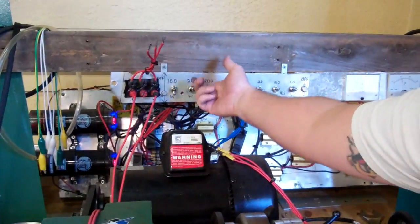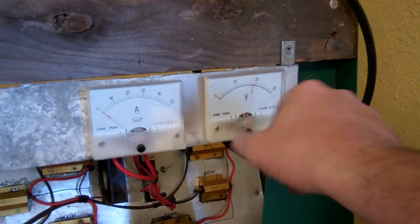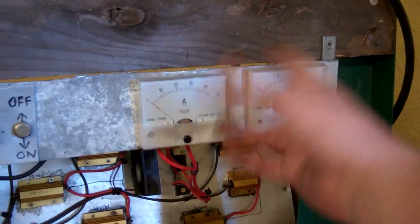Which we can see if we swap these loads back off — it immediately hits a peak upwards of 20 volts. So we know right away that the regulator is not working, but the rectifier inside is. Since that's not serviceable, this whole regulator rectifier unit is going to need to be replaced.